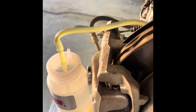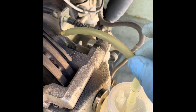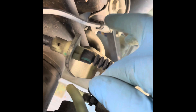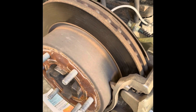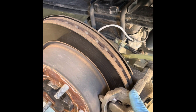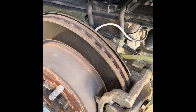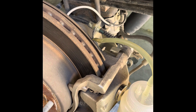Continue the pump-fill-check cycle until you're happy with the clear fluid coming through all the lines. You can see now we've pumped enough fluid through that we've got a clear color coming into our drain reservoir, whereas everything else is more of an amber color. At this point we tighten the nut back and put the little rubber cap back on, then put on the wheel and torque it to 100 foot-pounds with our torque wrench. Note that the first caliper you bleed will have a lot more fluid coming from it because the brake reservoir still had a lot of fluid in it — it has to bleed that as well as everything in the line to that particular caliper. The calipers after that will take much less fluid before you start seeing clear fluid come through.